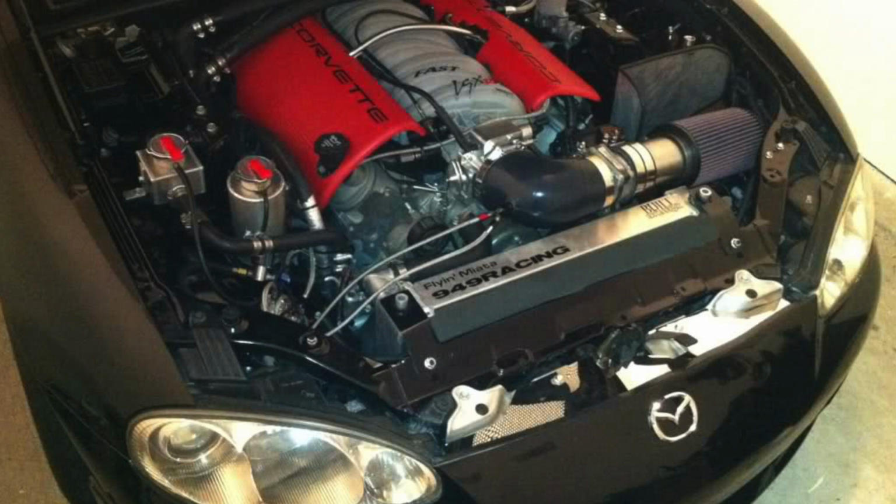The LS engine family is known for having smaller proportions than its competitors' engines, making it much easier to swap into cars with small engine bays like the Mazda Miata. The main reason they're such a compact engine is because of their old school pushrod design, as well as all of the modern technologies they used when designing the engine block. The pushrod design that they continue to use is almost unlike any other modern engine, which have overhead cams. You can achieve better performance and economy with an overhead cam, but at the cost of a much larger and heavier engine. Thanks to the all-aluminum design, a fully dressed LS1 is nearly as light as a cast iron 4-cylinder.